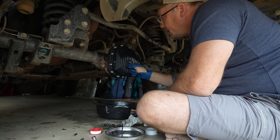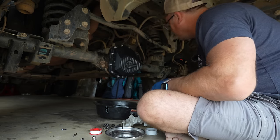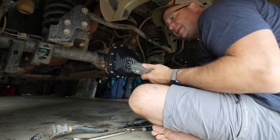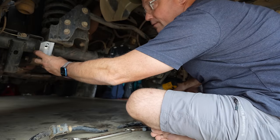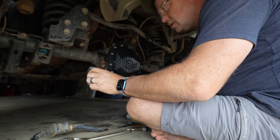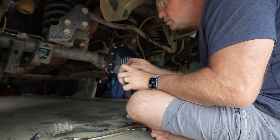The AFE deeper diff cover does require you to put shims on the rear sway bar. I don't have my rear sway bar connected right now because you have to put some shims in there, which they do provide. They just mount right up to the factory locations, and then the sway bar mounts up to the shims. They also include new hardware to mount the shims, so it should be pretty easy. For the sway bar itself, you just reuse the factory bolts.